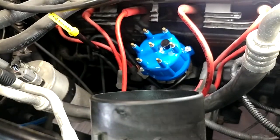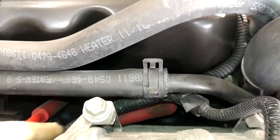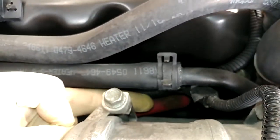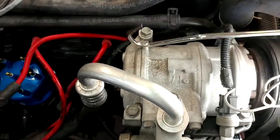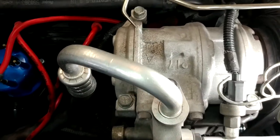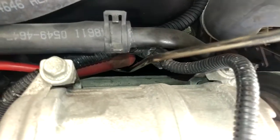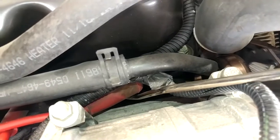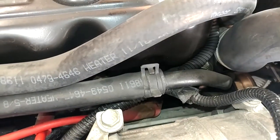The next thing is to actually start pulling plugs. The only one that's really any challenge at all is number one, which you can just barely see the boot for behind the AC compressor — and it looks like it's also going to end up being quite a challenge to film. I'm going to try and stick my index finger under it and pop that boot off, but I can't get in there with any plug wire pliers. New plan — I've got a couple of my pick tools here. I'm just going to try to get it tucked up under that guy and pull it off. Since we're replacing the wires I really don't care if I hurt it. There he goes — so I've now destroyed that wire, but it's off.